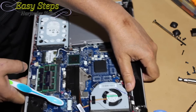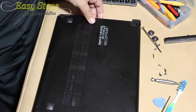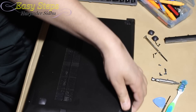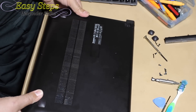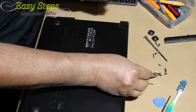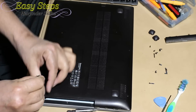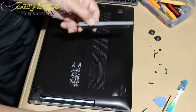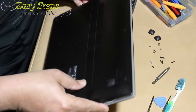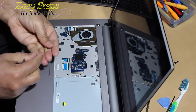All the vents look clean and perfect. Now we're going to put back the covers. Slowly drop the cover on top and then press it — as you hear the snaps, it snaps in. Place the three screws on the DVD side — these are the tiny screws. Once the three screws are tightened, place the other cover back slowly and press it — it locks in. Then go to the front side and place all five screws.